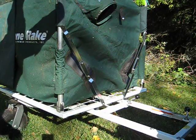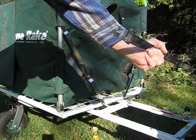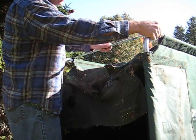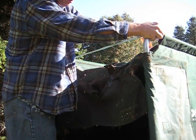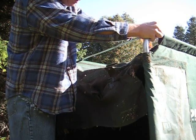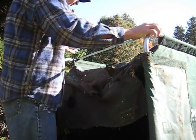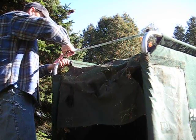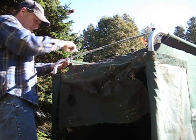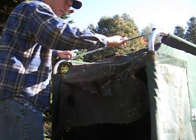This is how you get this bracket in the back. On the top there are two little nipples that hook into a hole already in the frame. So you take this bracket, put one nipple in the hole, move this little U-shaped connector onto there, adjust it properly, and once it's on there tighten it down so it won't come off. Do the same thing on the other side — loosen it first, put the nipple in the hole, loosen it enough so it will slide underneath, then tighten it down. That gives this thing integrity so it won't wobble or collapse.